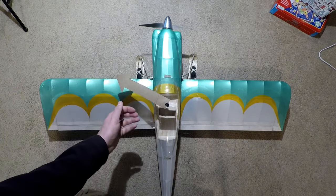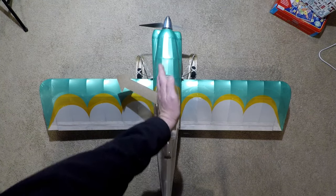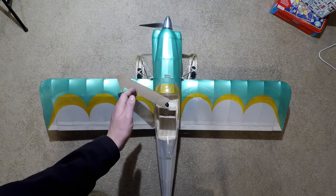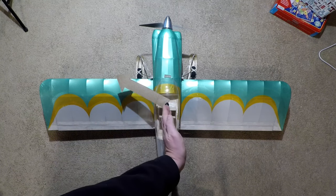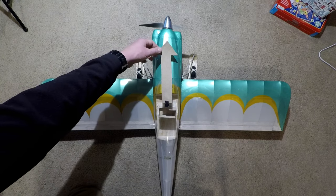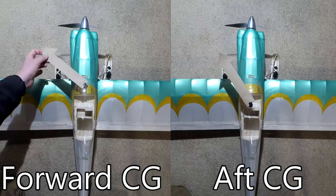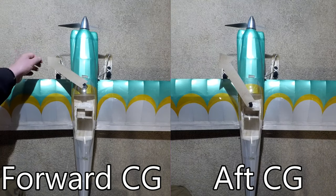This can happen during landing when you've got a crosswind, so you're crabbed into the wind — the airplane's pointing one way but actually going another. It can also happen on takeoff or a high-speed taxi if you turn too much and centrifugal force throws the mass out. As a quick note, if you have an airplane where you can't change the landing gear, you can try moving the CG forward. The farther forward it is, the more that arrow can turn.